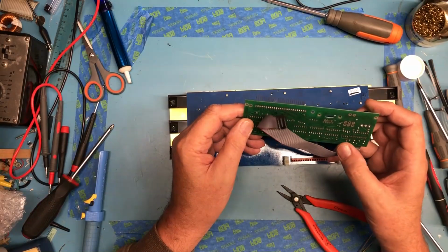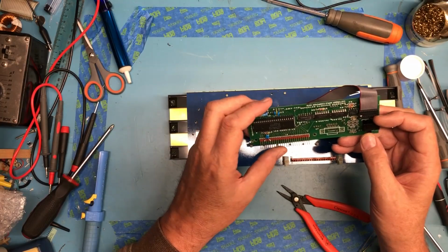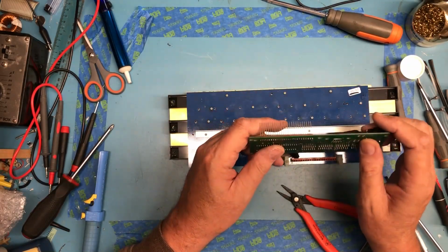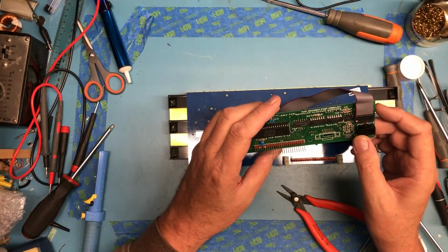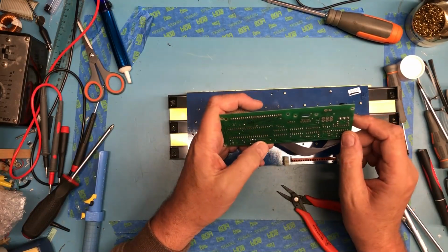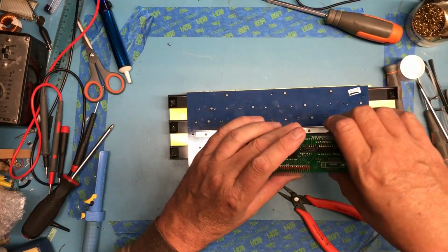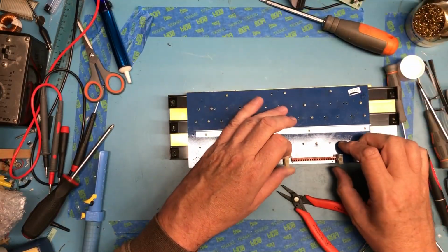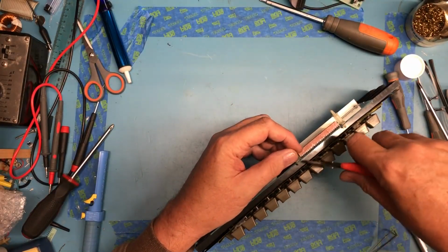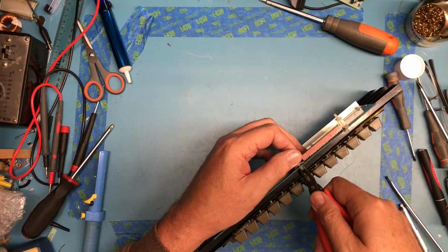There's a couple of interesting footprints on there. This one's actually wired in. It's got to be a DB9 for a serial keyboard. And it's picking up pins off of the controller chip. Maybe power or switch of some kind there. Anyhow, what we're really after here is seeing if we can get into this keyboard a little better and cleaning it up, just because it is so filthy.